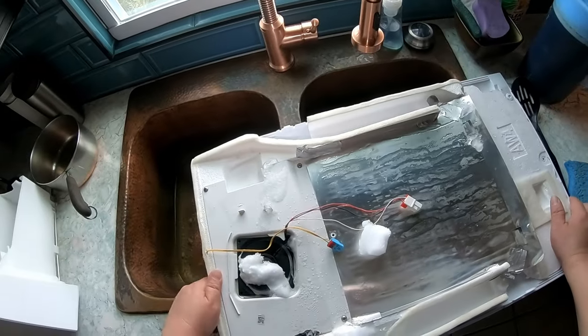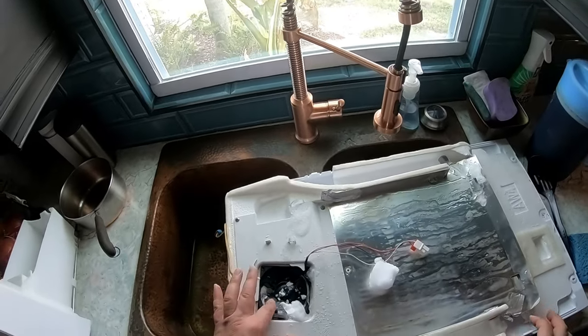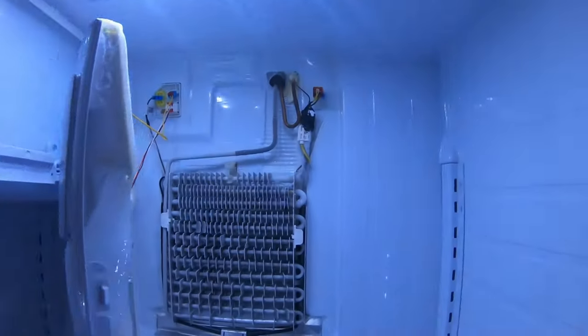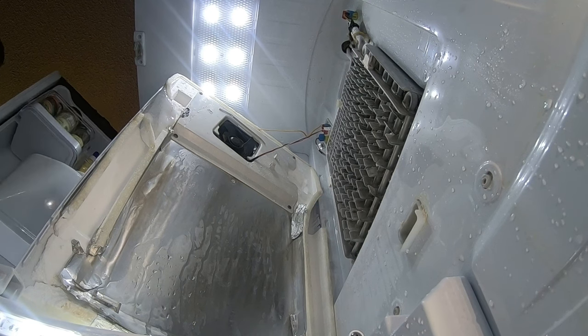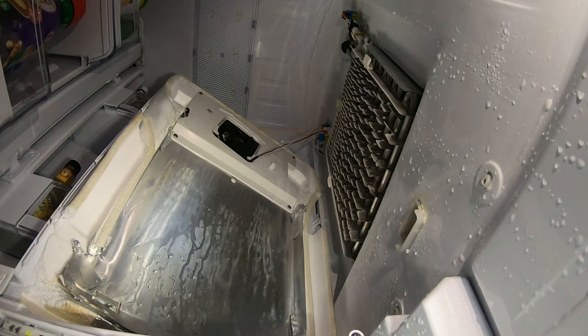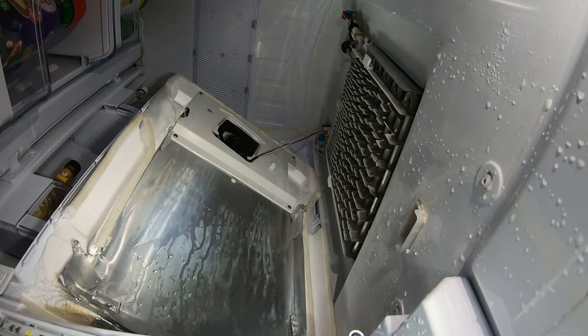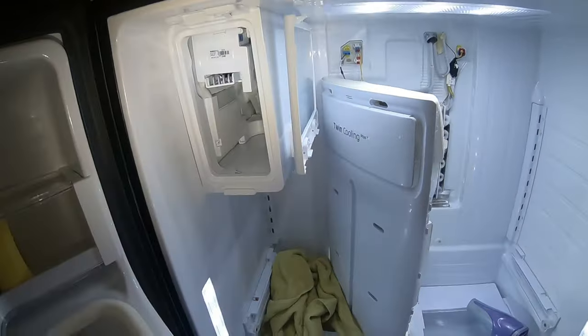I'm not happy with this — I already ordered a new part. Look at all the ice on the fan motor; the fan motor wasn't even spinning. Another reason they kept having to come back is they probably only defrosted what they could see. I'm going to do this right and show you how. I defrosted all the built-up ice with my heating gun and steamer, then plugged the panel back in to find out if the fan is still working. After fast-forwarding the footage, the fan is still good. This fan lasts a long time, unlike GE models. If the fan is working fine, the only problem is the thermistor.